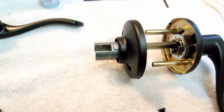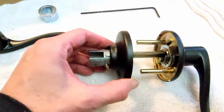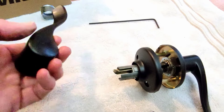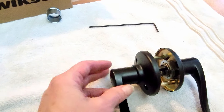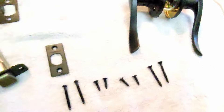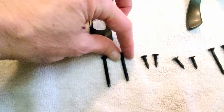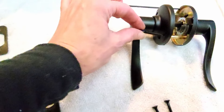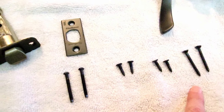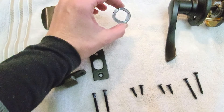This gets a little tricky because the door is going to be right through here, so you can't really see it — I'll give you a little trick when we're installing that. Once that's on, you can install the doorknob on this side and you'll have a doorknob completely installed. You've also got a few extra screws: the two bolts that go into the doorknob, plus a couple of short screws and long screws.